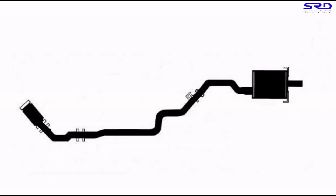Going back to that drawing of the exhaust — as the exhaust travels, before it leaves the muffler tip, it's already pulling the incoming charge from the header. Because it's interconnected, as this portion comes out, it actually pulls the incoming exhaust coming from the header. It's all fluid and flowing together, so this is helping scavenge. The better exhaust system helps exit spent gases and even some carbon buildup, creating a little more vacuum in the chamber. As the intake valve opens, air is rushing in, making it more efficient.